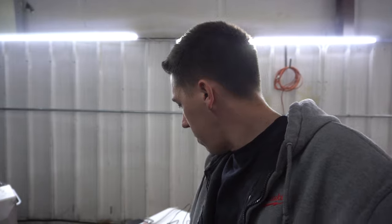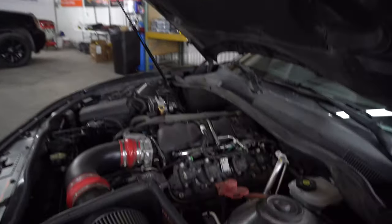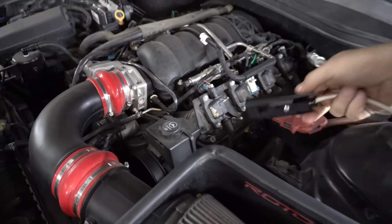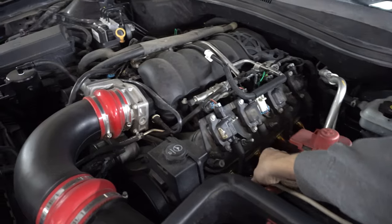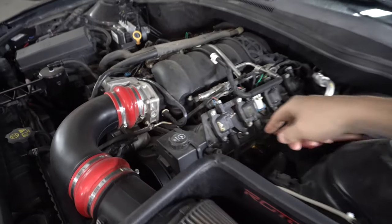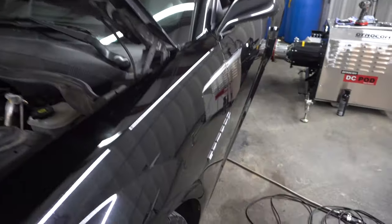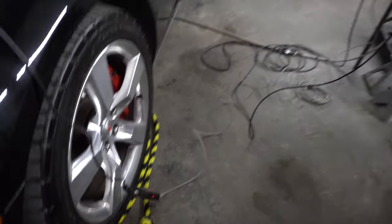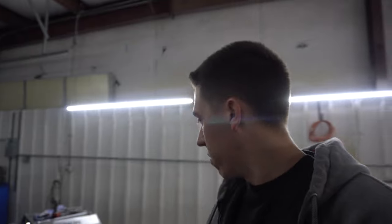You actually don't need the software — you can control it all through the box for stepping up increments. But to do that, it needs an RPM input. It comes with this little handheld called an RPM iBox. You can clip it onto a plug wire or one of the coil wires. This little box picks up the RPM signal and feeds it back to the main box. I'm going to use that to do some tuning and get the part throttle dialed in, then I'll need the software fired back up to do the full throttle power runs.